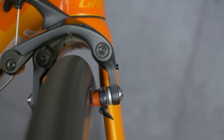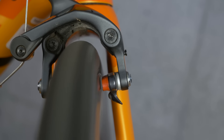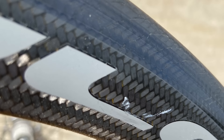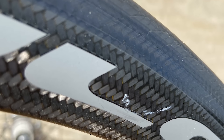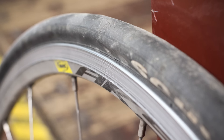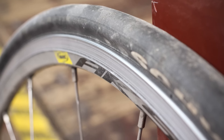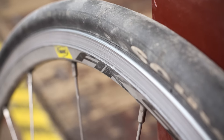It's no secret that braking causes wear — that's something you just can't get away from. However, you can decide what components get worn down. With disc brakes, those components are relatively inexpensive — it's the rotors and pads that wear out. But with rim brakes, unfortunately it's the sidewalls of your rims. That might not be the end of the world if you're riding low mileage or running cheap wheels, but it can definitely get you down if you've invested a lot in a set of very expensive hoops.